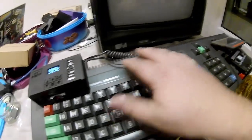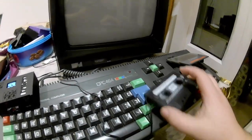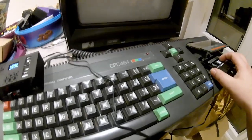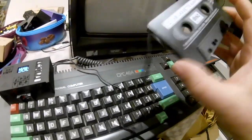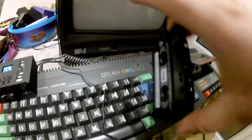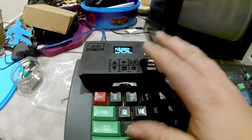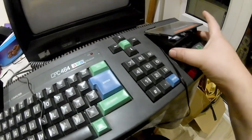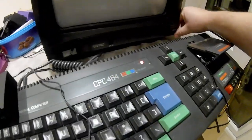In this combination we require a cassette converter device, because on the CPC 464 there's no exterior tape ports. So the idea is that we use this — it's got a cable connected to it. There's no tape inside here, and that audio cable connects to our CPC WeTape device. We put the cassette converter inside the Amstrad like this. Let's turn on the Amstrad.